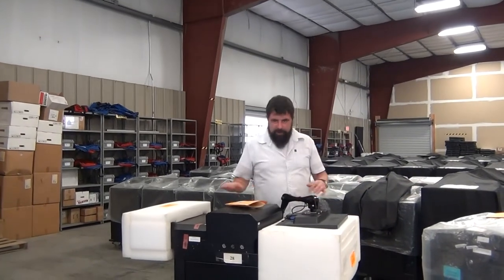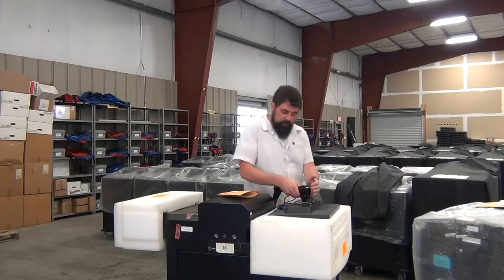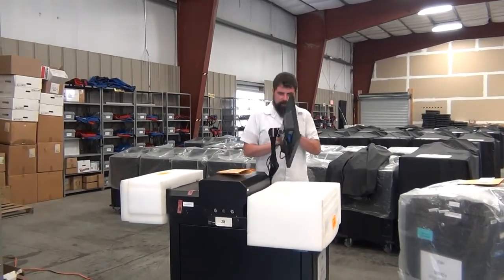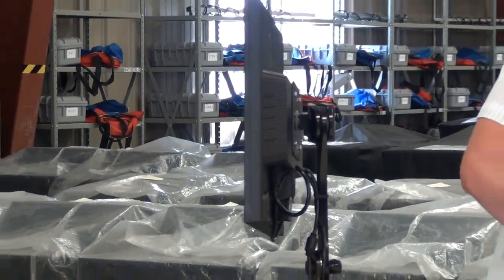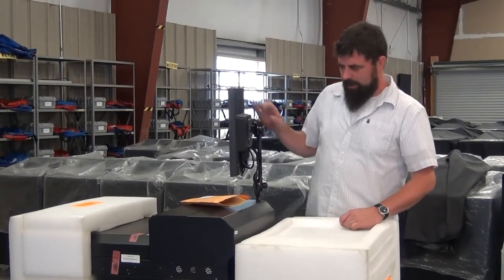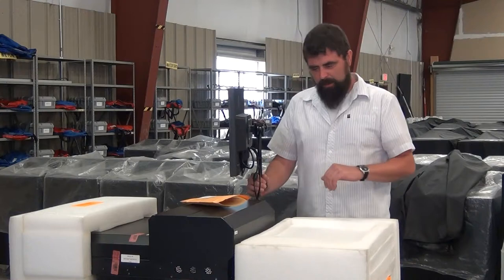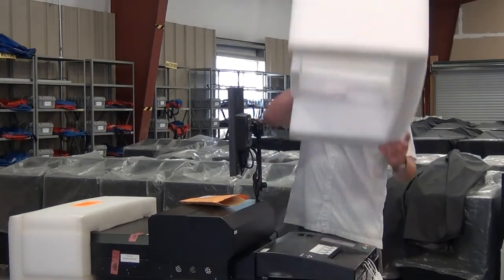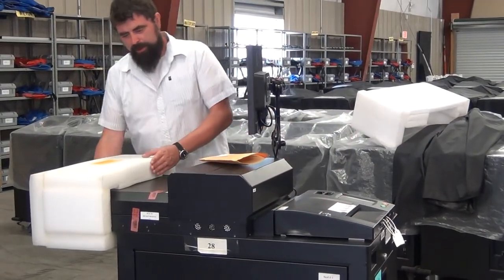For our BMD here, we have to remove these two pieces of foam. The one under the monitor we're going to have to lift up by the metal arm — this gets turned around to the back side of the machine. While it's tempting to try and pry the monitor out from the front, this plastic monitor is actually kind of delicate. If you come around the side and grab by that metal arm, you can yank as hard as you want and won't hurt anything. This piece of foam lifts straight off the top, and the back piece of foam we just slide off the back.